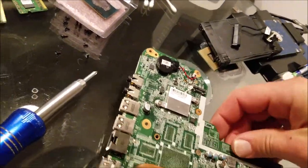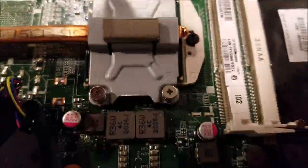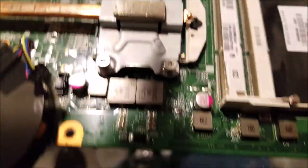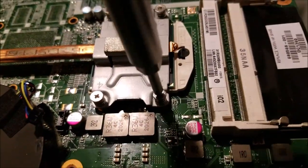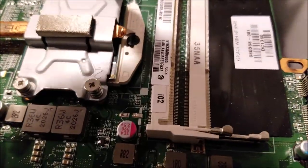What's on the bottom side of the motherboard is what we're after. The processor is behind these four screws. You can see the little heat pipe, a fan, and a little heat sink with some vents on it. Unplug your fan from the header there. These are captured screws and they are actually numbered too — you're supposed to undo them in 4-3-2-1 order, though I don't really think it matters a whole lot.